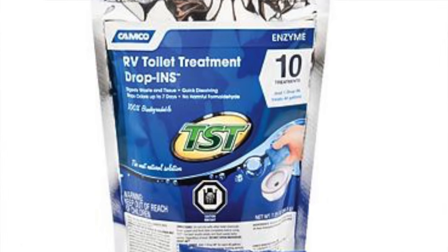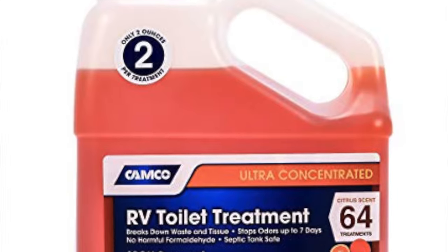Enzymes are another tip. You can look up natural enzyme recipes on Pinterest — just search 'natural enzymes for RV toilet' — or buy pre-made packs or bottles at Walmart or RV stores. After you've dumped everything, put the enzymes in and they eat away any remaining residue since you can't physically scrub inside your tank. This prevents odors from coming back into the RV. We also recently learned to add a capful of laundry fabric softener, which helps while you're driving — the movement stirs it around.